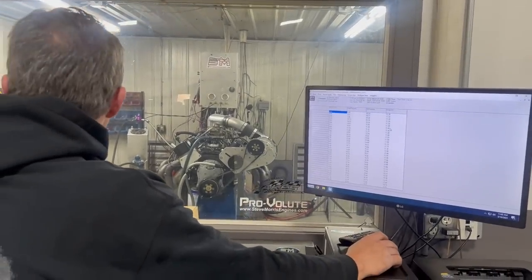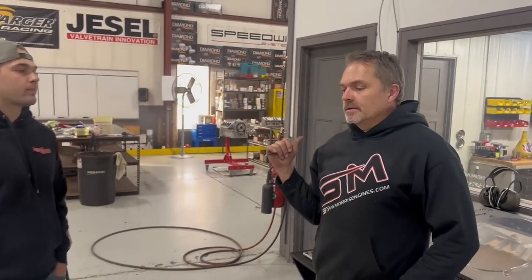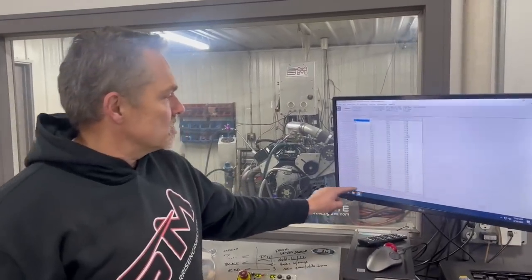So I think we'll end up having one more in this thing, Kyle. Where'd you go? I think we'll end up having one more in this thing, and let's pull all the plugs and just look at everything to see what it looks like. And then we'll stagger up these jets maybe just a little bit more. And I just wanted to get this so it's like 12.5 or so at 70...